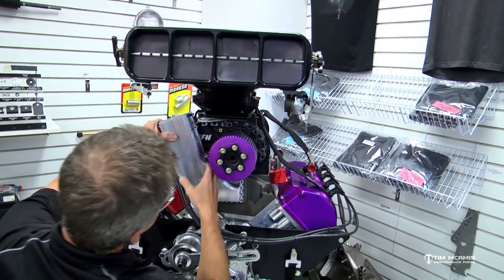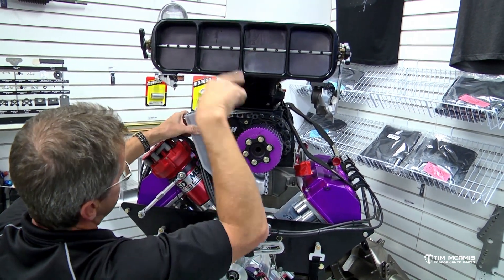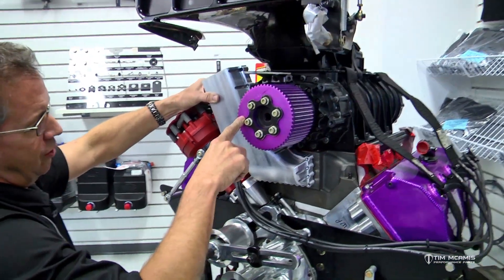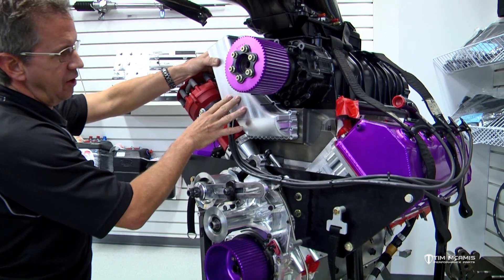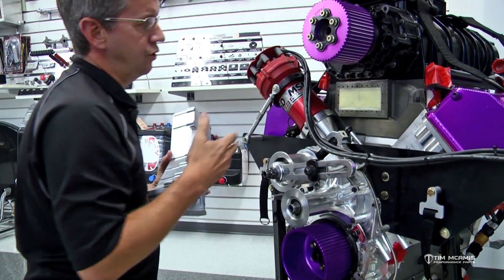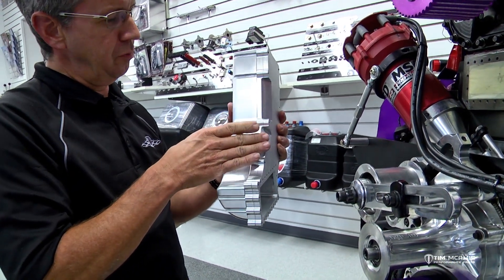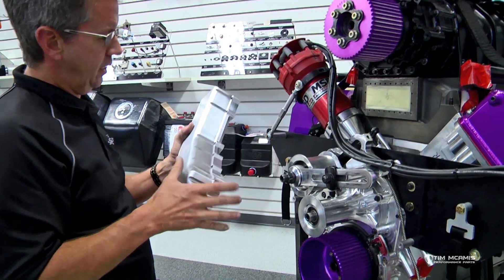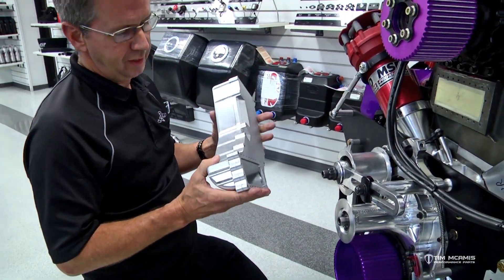The belt and belt guard will just clear the front of it. With the slots in the back, the blower can still lift off — and if you've seen our videos on our supercharger lift tool, you can just flip the straps up, take the bolts off, and lift it right up and out of the way. This stays on the manifold while servicing, or you can lift the whole package off together. It's also plenty meaty on the back so if you have a different supercharger configuration you can relieve it. We want it to direct the force out from the manifold and not be contained up front — if you need to cut a little more off the back, it's not a problem.